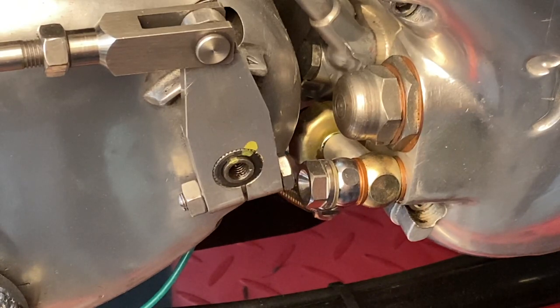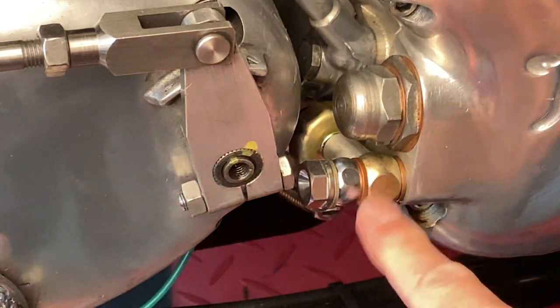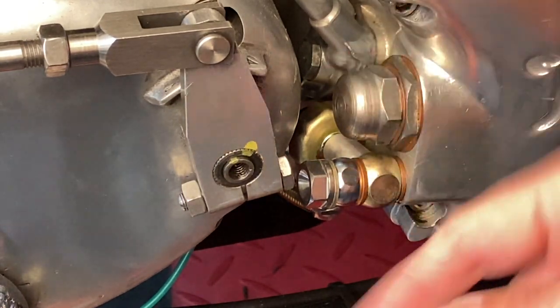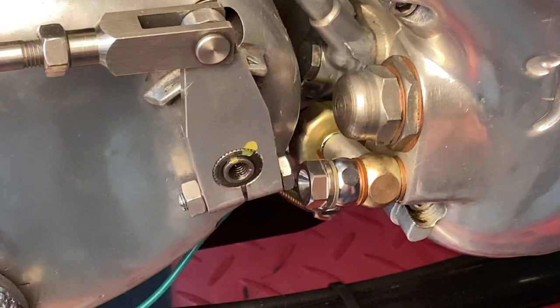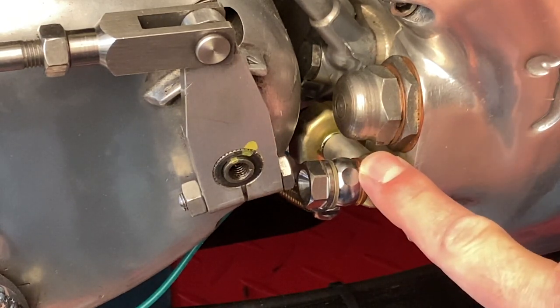On this side we can see the installation of the oil pressure switch. The switch is actually back behind, coming off of the rocker oil feed — there's a stainless steel braided line that goes up to the head. This junction here is the oil pressure sensor. You can see the green wire that we connected to the switch on the other side. I happened to have a section of green wire with the right fittings on either end and approximately the right length, so I lucked out there. We'll start the bike up at some point and confirm that the pressure sensor switch works.